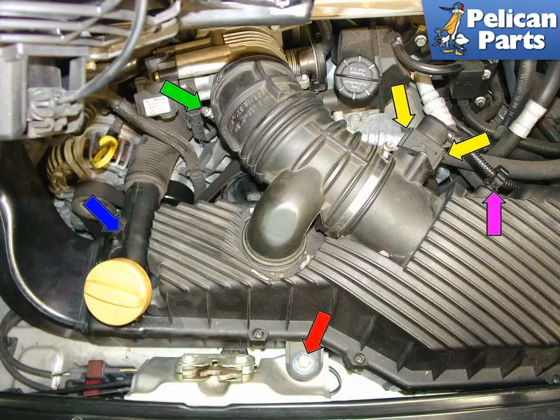Open the deck lid and remove the air box. Begin by loosening the hose clamp holding the boot to the throttle body, indicated by the green arrow. Then squeeze the tabs on the MAF connector to release it, as indicated by the yellow arrows. Now open the harness holder clip, indicated by the purple arrow.